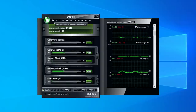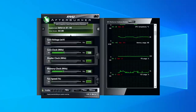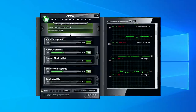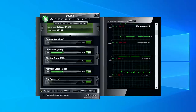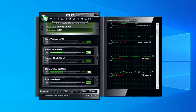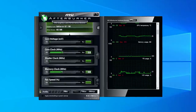Initially I settled on a 350MHz increase to the core clock and a 300MHz memory increase, even though GPU-Z told me that the memory speed had only increased by 150MHz. While editing this video I saw David Does Tech Stuff's video with the same card, and interestingly his 710 maxed out here as well. So David, you didn't lose the silicon lottery — the card just hates overclocking, or maybe we both lost.